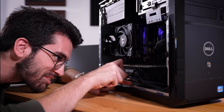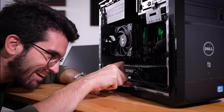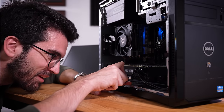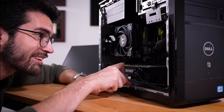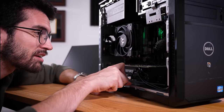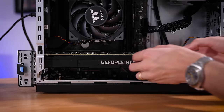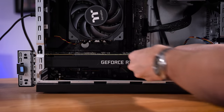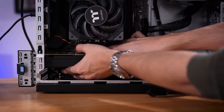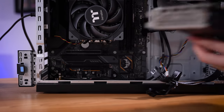We're going to keep this in the back of our head. Although since power cycling this rig once more, it doesn't want to power on again — I've never seen this before. This is very strange. I'm jumping the power pins and it should be turning on, but it is not. It looks like it's still receiving power. This is really bizarre. I believe this CPU has integrated graphics, so I'm going to bypass the discrete card entirely. I have cleared the CMOS off-camera and that hasn't fixed anything.